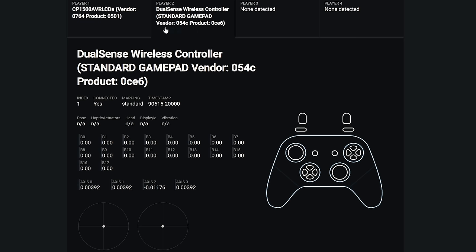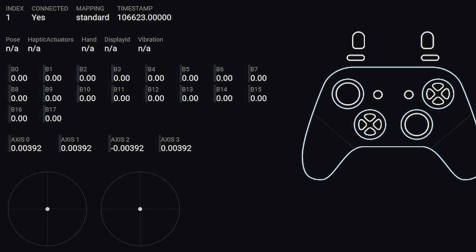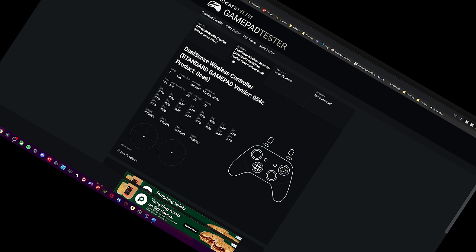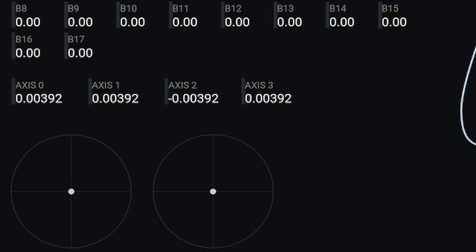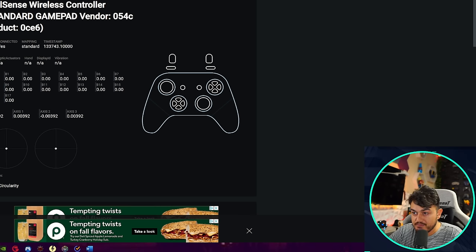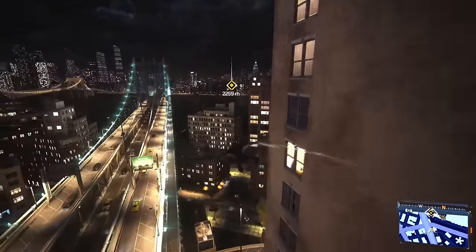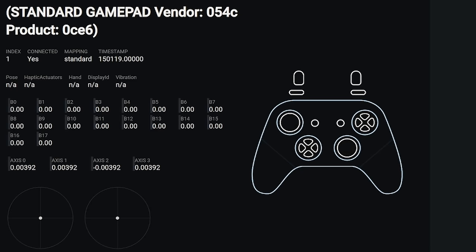Over here in GamePad Tester, these look like standard potentiometer thumbsticks. As I move them and stop, they snap back to a default resting value of 0.00392, pretty consistently. What you're seeing on Axis 2 is commonly referred to as noise or jitter — when sitting at neutral, it's jittering back and forth a little bit. Prior to Hyper getting their recalibration boards, which made this a new gamepad, they would constantly be like this. Even if you don't notice it in gameplay, if you bump down your in-game dead zone sensitivity, you might actually see that movement, and that additional noise isn't going to help your accuracy. Luckily, that is not the issue with the current HE sticks from Hyper anymore.